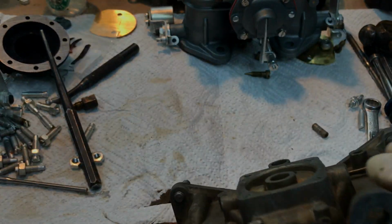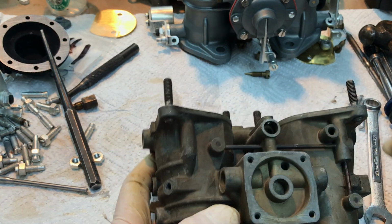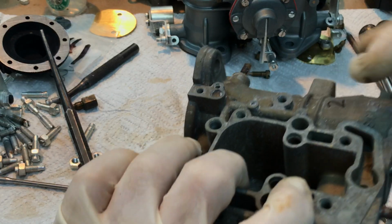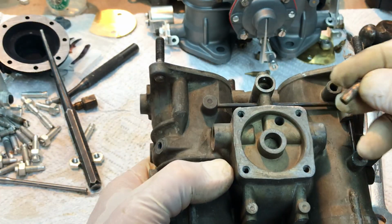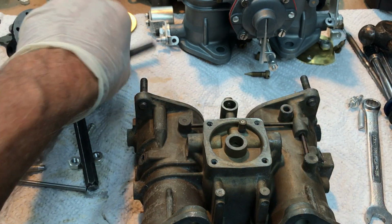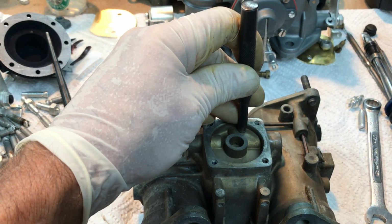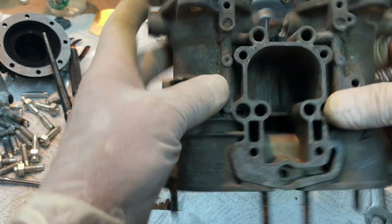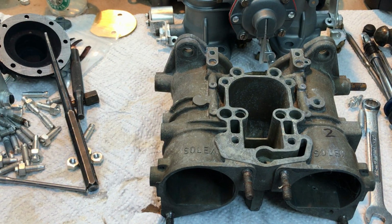Okay, that's why I say you've got to take apart the carburetors in order to replace this little check valve, because the check valve comes out from the inside down to the bottom, but it installs from the bottom going back in, and that's because it's on a taper. This is tapered, so that's how you take it out, and that's how you install it. And those need to be replaced periodically, and I've got those in stock, and we rebuild those or have new ones. So those are the things that I can think of that would affect the vacuum.